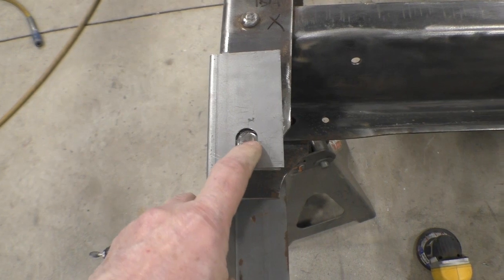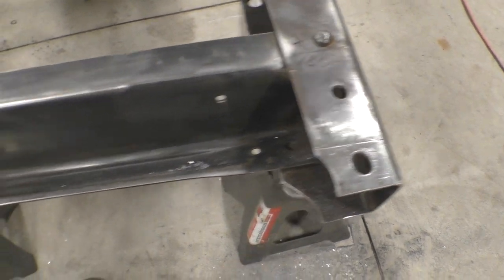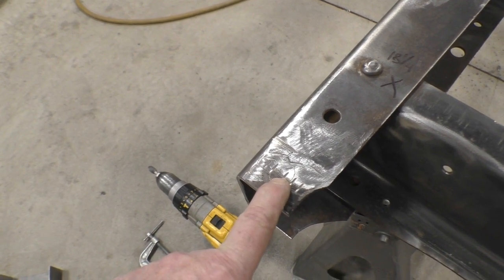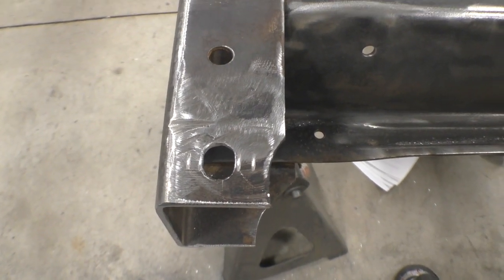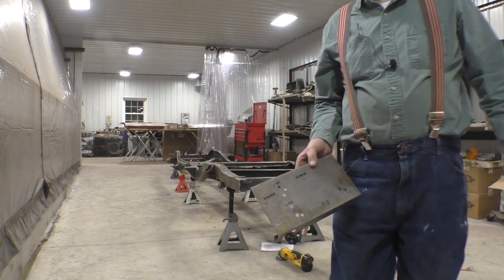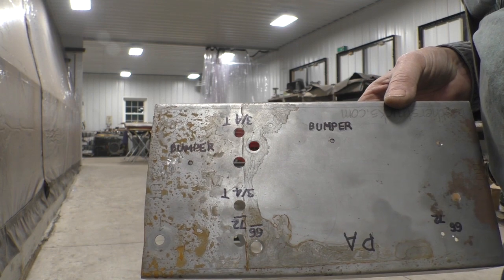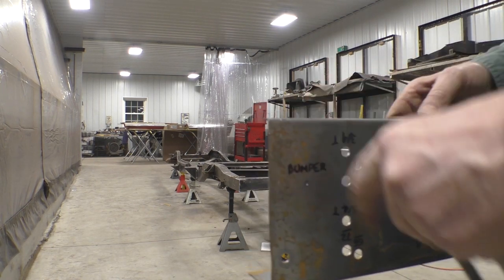We've cut the frame off. We still have a traced oval that we have to get rid of and make it look clean. The way I did that is I drilled a hole and then used a carbide bit inside a drill and ground out anything inside the oval. With some patience you can get a nice oblong hole. The next step is to put this pattern up against the rear frame again — the eighth-inch holes marked 'bumper' we're going to drill out for bumper mounts, now six inches further back using the same gauge we used to cut the rear.